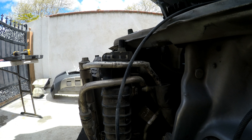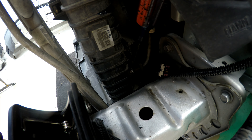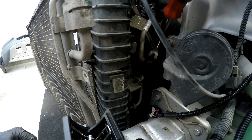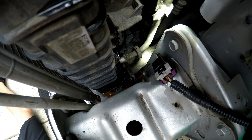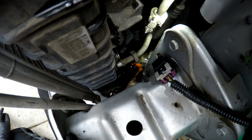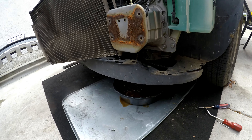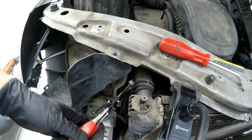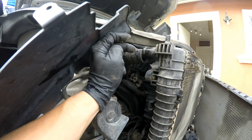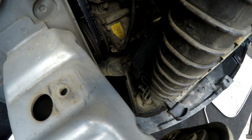There's the upper transmission cooler line disconnected. Here's the lower cooler line. There's the lower radiator hose off. Make sure you've got a pan, mat, everything that you can so you don't make a mess. The fans are held on by one bolt on the top right and then one on the top left, and then they just slide into the bottom. 10mm.